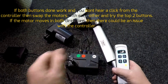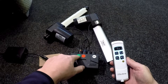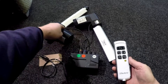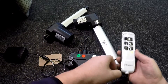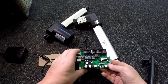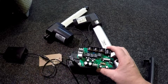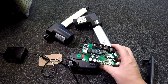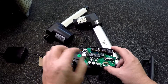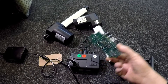Technically, these buttons will now operate the foot motor and the backrest buttons will operate the other motor, because the connection goes through the relay inside. I've opened one to let you have a look — but I advise you not to open it, because number one, that will void any warranty you may have. This is a 29-volt system. There may be people who can repair these, but we tend to replace them — the time and effort involved isn't worth it. It could be a faulty relay, it could be water contamination — we just replace them.